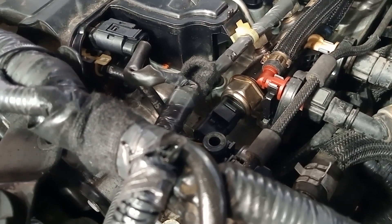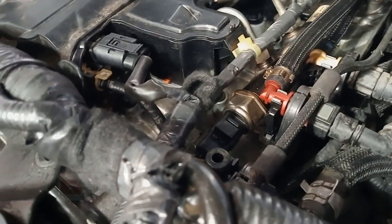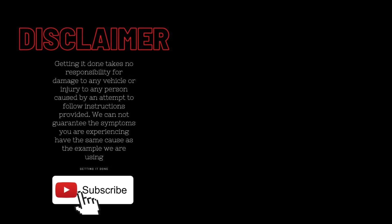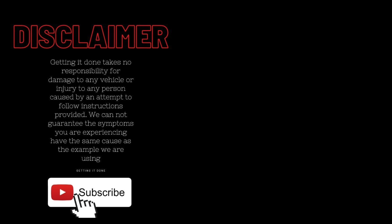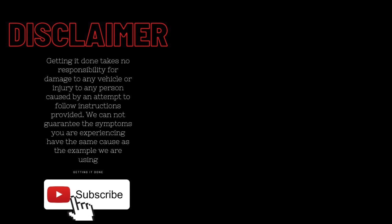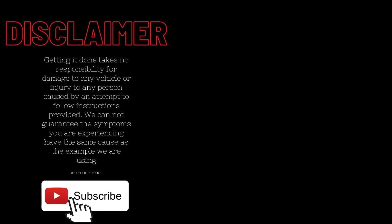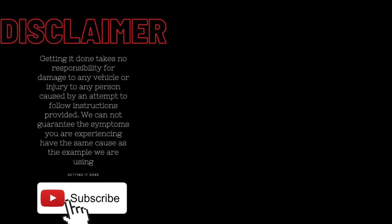The customer is going to take it away and make sure it stays good. And it has stayed good — it's been weeks now since we did this and it hasn't been back, no complaints about it. So it could be that loose pins in that plug are a common issue. Make sure you check that out before you go replacing a sensor that doesn't need replacing, just by moving that wiring while you're checking your live data. That is the P0190 code on a Nissan Navara D23 or NP300.